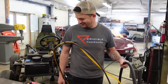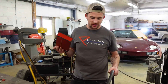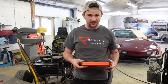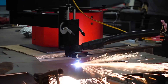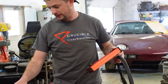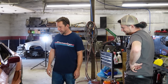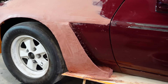I think we figured it out. Whenever it's on the table — which is grounded to the same piece that we're cutting — it gets interference and it cuts off. So when I'm holding it, though, it has not done that. So let's see if it'll work again consistently. That's it, dude. So basically we just need a shield between this and that. It doesn't need to be behind your back. I think it's all right, but we can make that adjustment if we need to. I'd get the bulk stuff flushed out and then start fine-tuning.